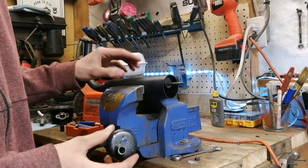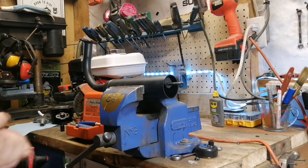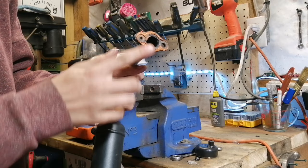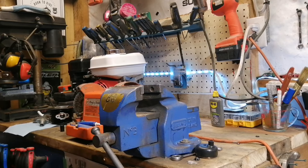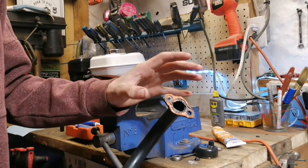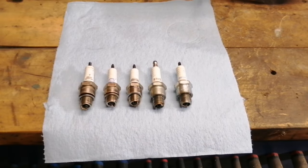Basically those are just more outlets — whatever gas doesn't go in the tube will come out through those holes and increase airflow. So you can either cut the exhaust tube out or drill some extra holes. The other thing a lot of people don't talk about: there's no point modifying your exhaust if it leaks. I've applied some Ultra Copper silicone sealant — it seals up exhaust really well. You can buy a gasket for eight or nine bucks every time, or buy this stuff once and never worry about it again.